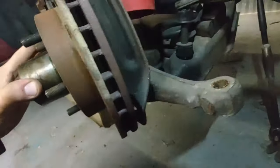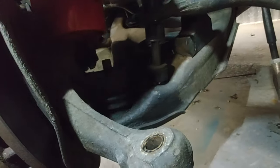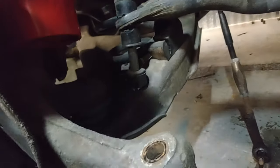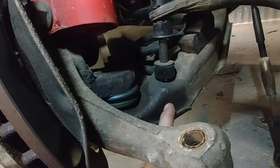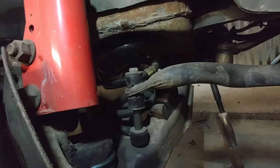I'm going to go for the ball joint right underneath here, and then the sway bar link — take that loose and take that loose. There's going to be a lot of spring pressure on this A-arm right here, so when this ball joint comes loose this thing might go ka-doing and shoot down. My first tip of the day: when you got your ball joint loose and the spring is still in there, a little trick is you can just tap on the knuckle right here — that's a good way to get your joints to come loose. It works for tie rod ends too.